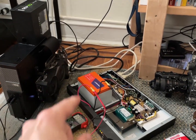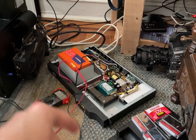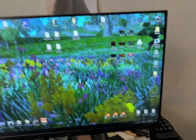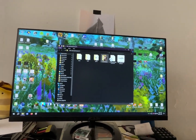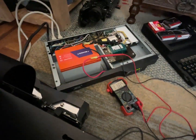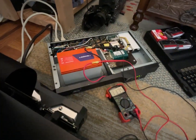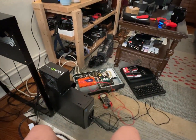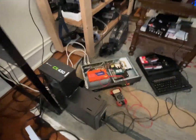The question is: can this 12 amp hour battery actually provide the full 300 watts that this UPS needs? To test that, I'm going to open up the Final Fantasy XIV benchmark. It's about 240 watts. Does it give out? It didn't go out, but that started flickering that light real bad. So that's about the maximum power, I think. It did survive it, but that did not like how low that voltage went.